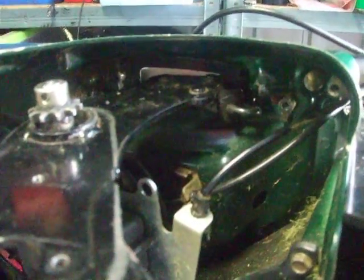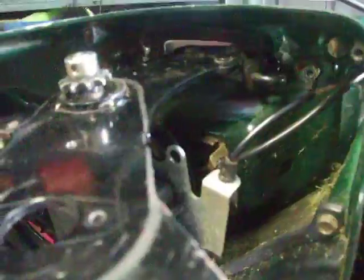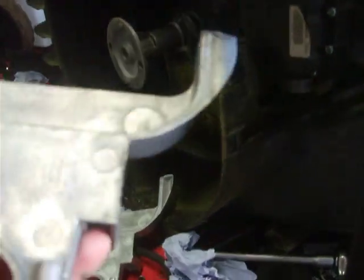What I'm suggesting is, if you have one of these, check it. Even if you've got no faults with it and it seems to run fine, just check it once a year. Basically what happens is the end snaps off. Now this holds, on this end, this bearing on. So it can actually tear this bearing out if it gets at the wrong angle, if it's too far gone, and cause lots of damage to the chain and stuff.